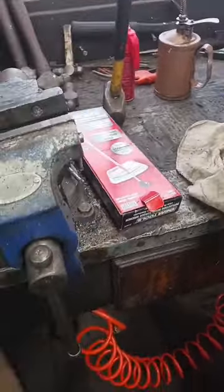So right now, he had also recommended on this spacer, he recommended putting some little gasket sealant. Put some here, well, basically on both sides, right? Put some on here, put this on, and then put some on top of this. Whenever you do reinstall it, he said it gives it an extra security should somehow it want to leak past that seal a little bit right here. Yeah, and we changed out this gasket.